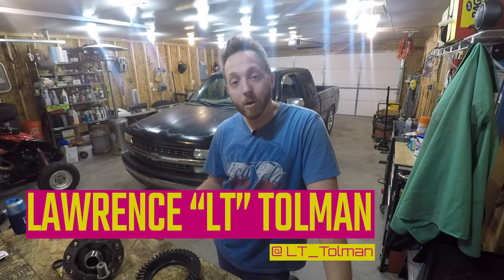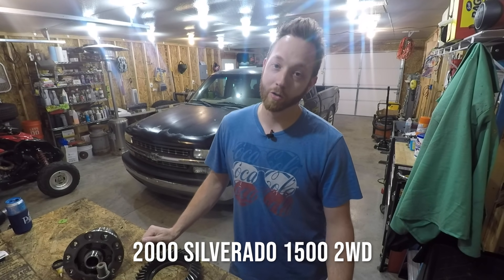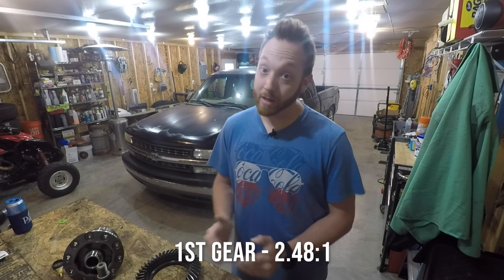How's it going YouTube? Since you guys saw the ugly truck last, I've put about 300 miles on it just making sure all the systems work together, and I don't like how the truck drives. The chassis is great — everything suspension-wise is brand new and the transmission shifts great — but the one problem I have is with the gear ratio. This thing has 3.42s in it and when you combine that with the 4L80 it has pretty poor acceleration, especially from a dead stop.